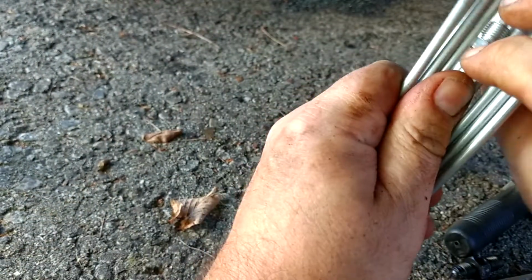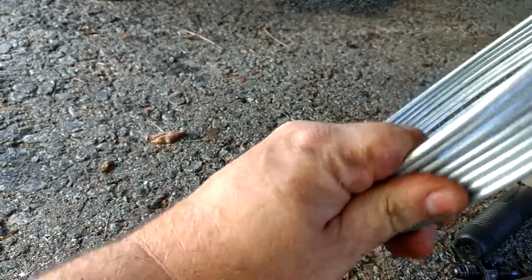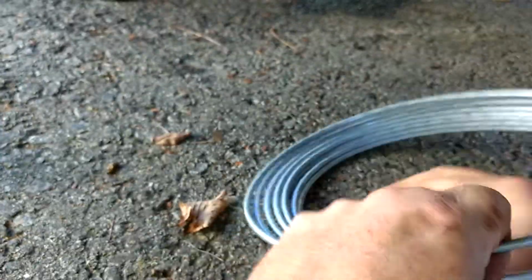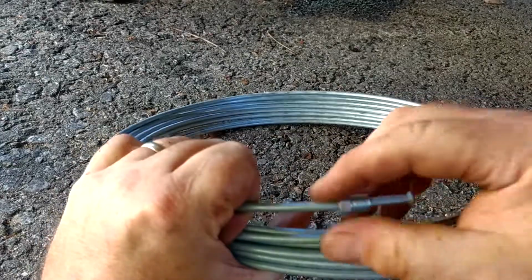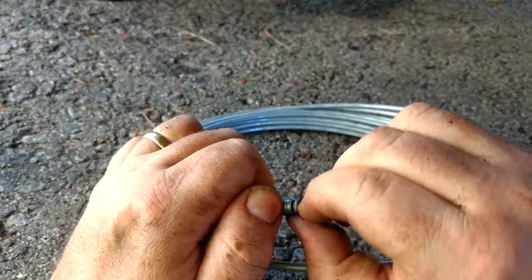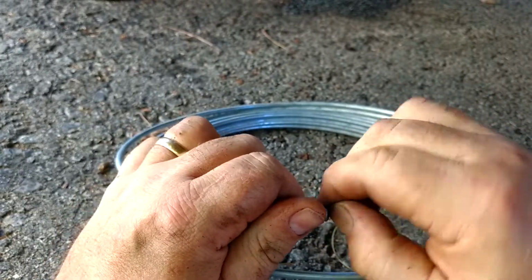Not too bad. But if I didn't have the open end, or if I already made the other end, I'd be having to cut that beautiful flare off. And thankfully with the right tools, it's much easier to make them up. So there it is. Look at that. Like nothing ever happened. So it's a beautiful commercial quality flare. And we're gonna make up the other side now.